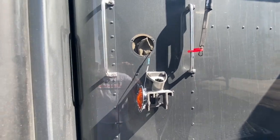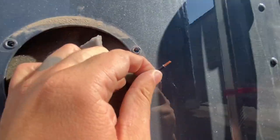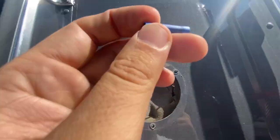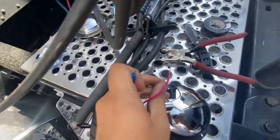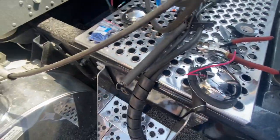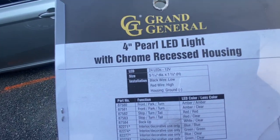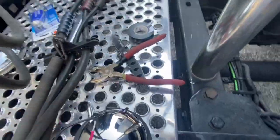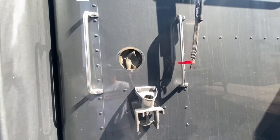Let me take this off, put it on, and I'll show you guys the before and after. You can see I took out the light, left the little wire exposed. Pretty much you're going to get your butt connector on there — there's aluminum in the middle, clip it down until it holds tight. On these lights the black wire is low, red is high — you can confirm that with the back of your box. I put a little electrical tape on and these come with a gasket already, but I'll put a little silicone on the inside to be on the safe side.